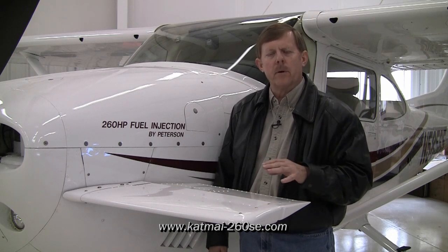All these things occur because of the canard. Wind tunnel testing showed the canard generates as much pitch authority as the elevator on the tail at an approach speed of 45 knots. We all know Skylanes have a tendency to bang up nose gears because the elevator is relatively ineffective at slow speeds. This kind of addresses that issue — it gives a lot more pitch authority at slow speed, so the danger of banging up a firewall is really reduced.